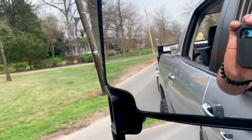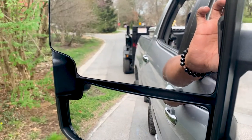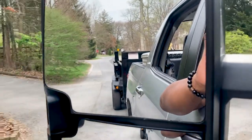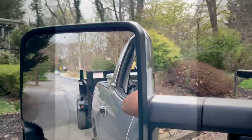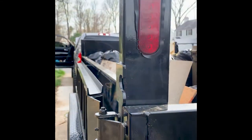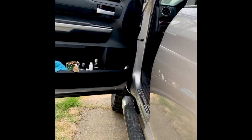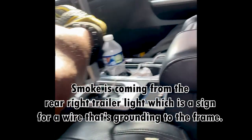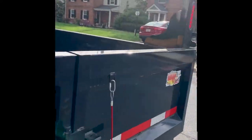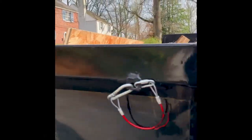The yellow light is on as soon as I come to a complete stop — as you can see it's flickering. I checked all my fuses and relays and they're okay. The lights are on but we're not getting any signal light output. When I turn on the turn signal you'll see that it starts smoking — the turn signal is on and it's smoking. Something's definitely wrong.